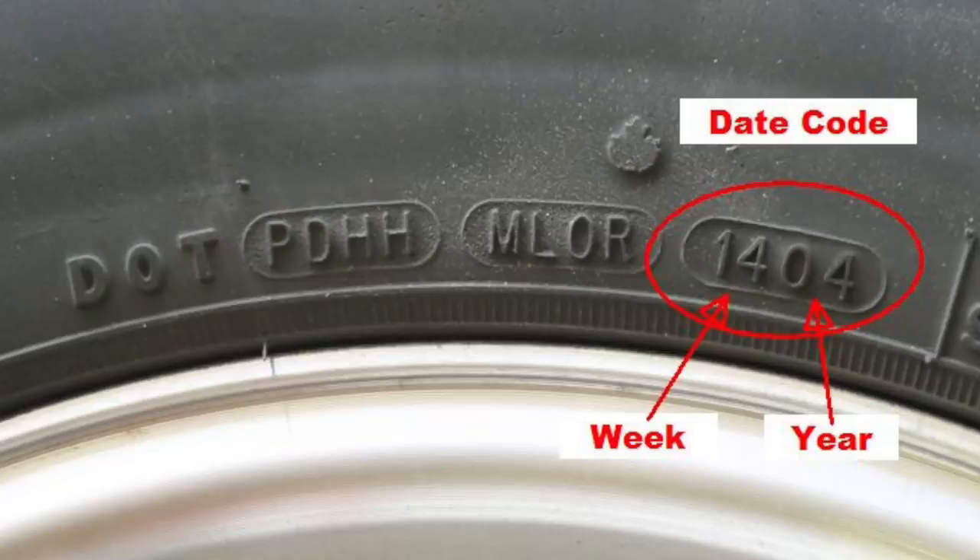Number six is the age of your tires. If you bought your van in 2018, you might think the tire age starts then. However, those tires could have been sitting in a warehouse for a year. Tires should generally only be about three years old before you replace them, regardless of when you purchased the van or when they were installed. There's a four-digit number on your tire — the first two digits are the week it was created and the last two are the year. Make sure the tire age is no more than three years, especially if it's been sitting in the sun. If you're nearing three years but still have tread, inspect carefully for cracks and tears.